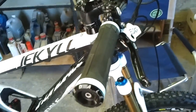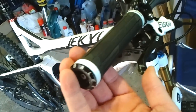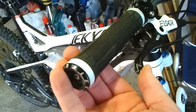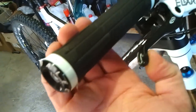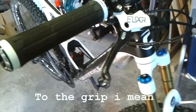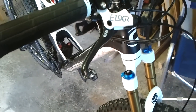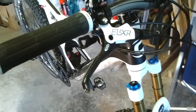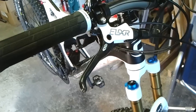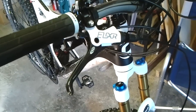The brakes. When I first did it, actually, I went for a ride and went, oh no, I've really screwed these up. They still feel pretty spongy. But after a ride, they really came good, and they got quite a bit of pressure there. I mean, I could pull that right back to the lever before, and the shop said no, they don't need bleeding. It's just the pads. So I don't know what was wrong, but anyway, I bled them. Decent brake fluid. Maybe they have shitty brake fluid stock. I don't know. That's a possibility. Maybe someone in the know could tell me.